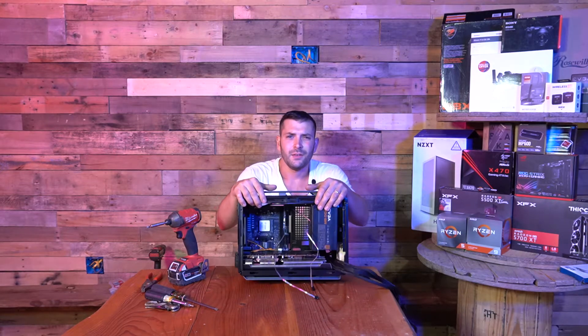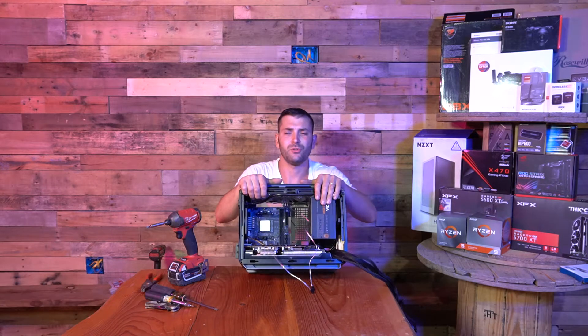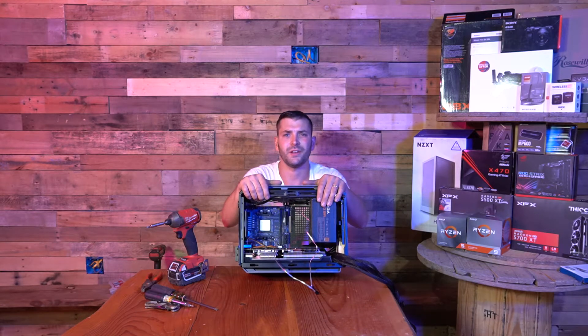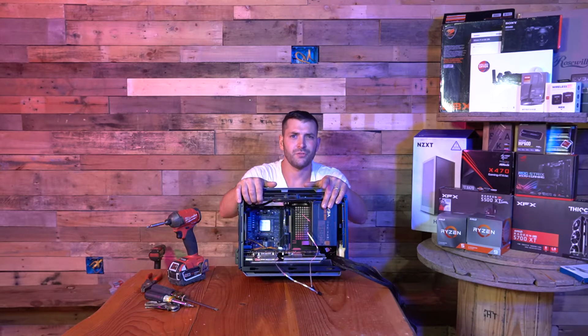In this video, you're gonna see how I have both 120mm fans up top and rotated my power supply in just a few short minutes to get some extra exhaust out of this case. With the orientation they have the power supply, you cannot get the 120mm fan in the front, and you're sucking air from the power supply from the side cover.